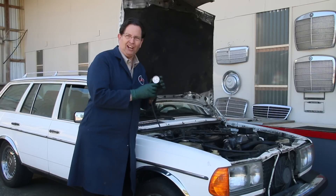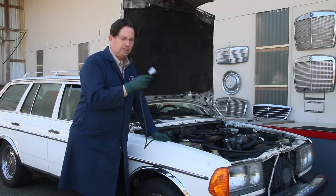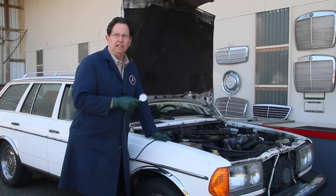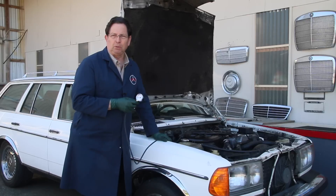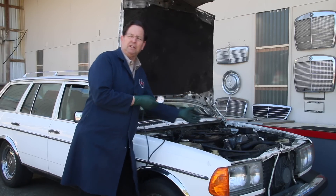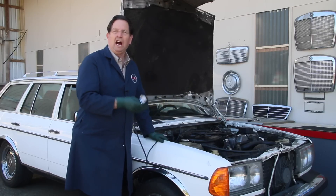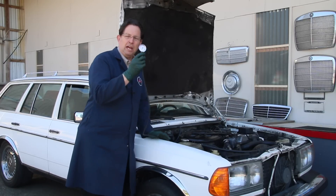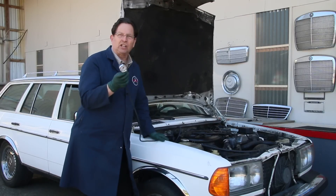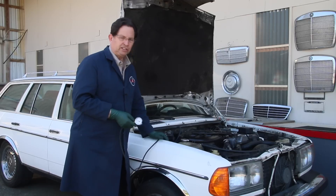I have put this gauge on. This is our little turbo test kit - a pressure gauge which I'm going to put inside the car. I'm going to go out and drive this car and just see how much boost the turbocharger is producing. Maybe it's not producing any boost at all. Maybe there's something wrong with the wastegate or the turbocharger. Maybe it's worn out. Putting this gauge on the intake manifold and driving it is going to give me some idea how healthy the turbocharger is.